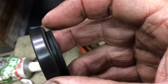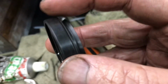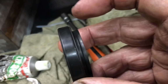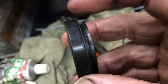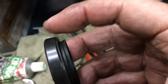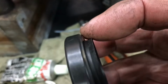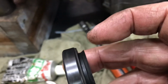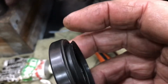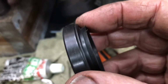So I've got 2 decent ones. My theory is that this 94 engine had new seals put on it when it had, I think, new universal joints put on it. Given the condition of the clutch in this 94 bike, I think the bike's done a lot more than the 1,700 kilometres that the odometer indicated. I think it's probably done as much or more as the spare engine. But along the way, it got new rear uni joints and I think new seals.